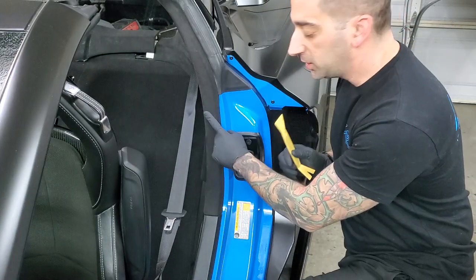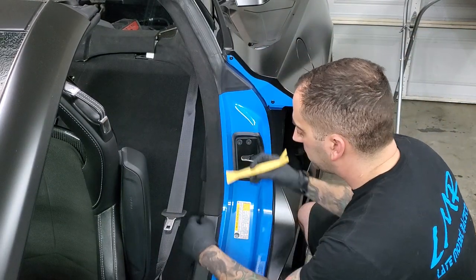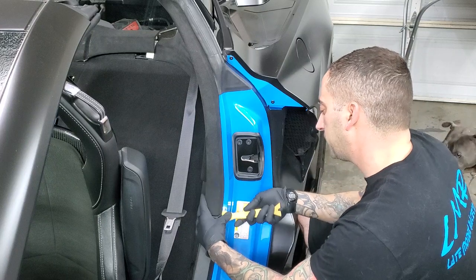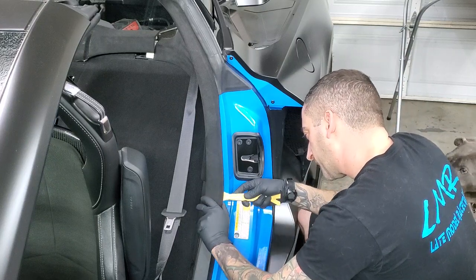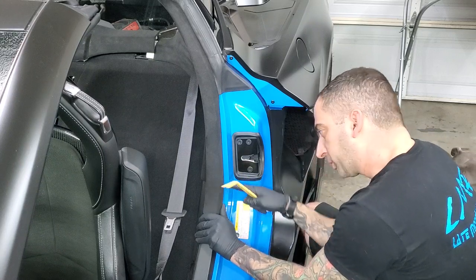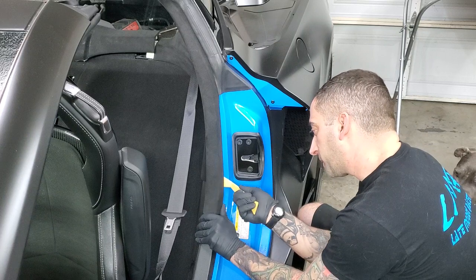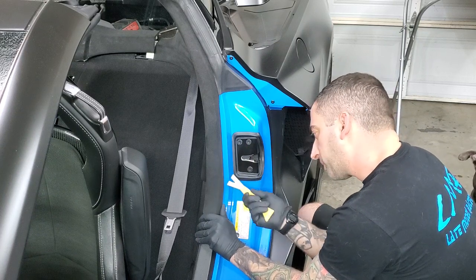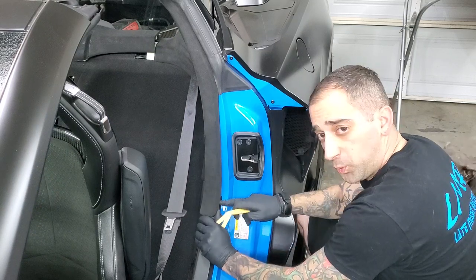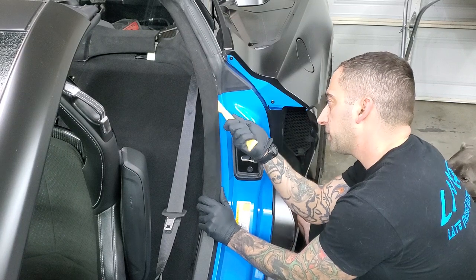Now I've got to get this piece out right here. This piece has a series of clips — two of them down here, one up here, a center one, and another one that holds it in. They're going to be very strong and it has to come out in a very certain way. Start about right here — there's one clip there that you'll be able to see to get it out. Just stick your plastic trim pry tool in and work your way up. If you go down here you might be able to see that one too. Get a little purchase, stick your finger underneath, and then look in at that bottom edge where you can actually see the clip. Reach in and use the pry side to give it a pop and out it comes. There's one down here and a third one up here — work your tool up there and pop that one out as well.